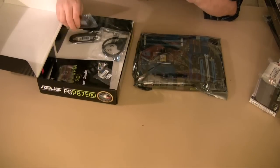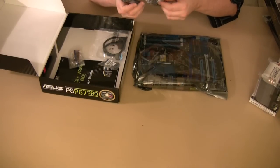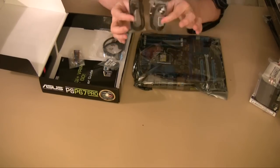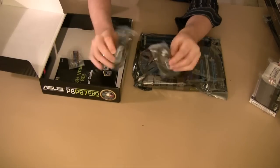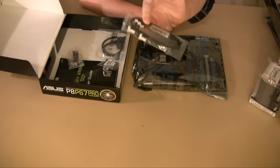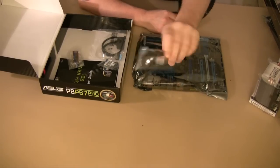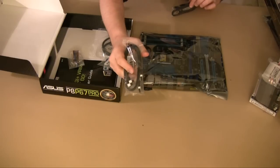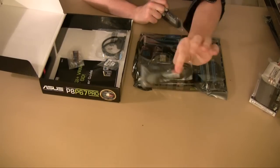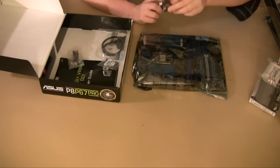Not sure what this other item is — we'll figure it out later. It said it was going to come with six SATA cables, but it looks like it comes with four, which is actually all I need. There are two different types of SATA cables here. The ones with the white part are for SATA 3, the 6.0 gigabit per second SATA, whereas these are your traditional SATA 2 at 3.0 gigabits per second. The hard drives I got do support the 6.0, so we're going to use those for my primary OS drive, and the slower one will be for my large video storage drive.